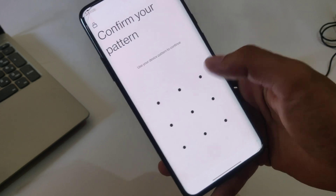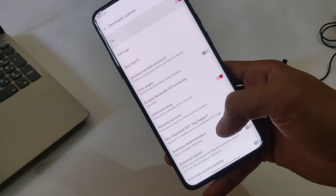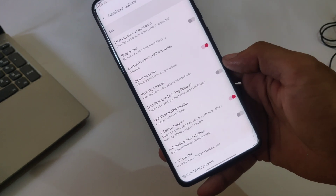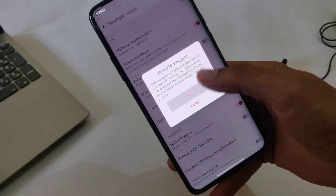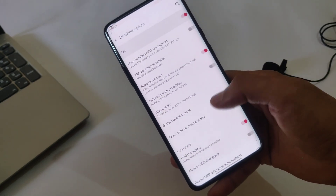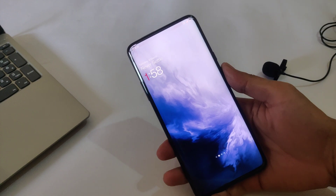As you can see, my device is not unlocked yet, so you need to enable OEM unlocking — it is now enabled. Also enable auto reboot and enable USB debugging option and click OK. Now it's time to put the device into bootloader mode.